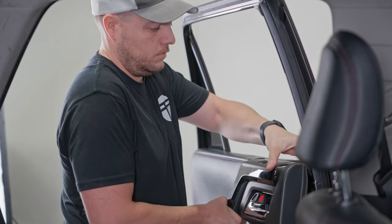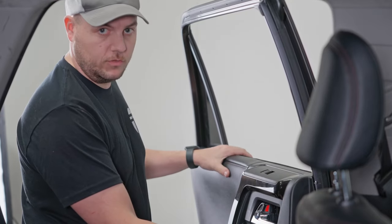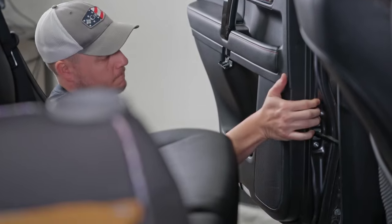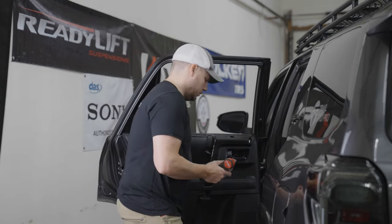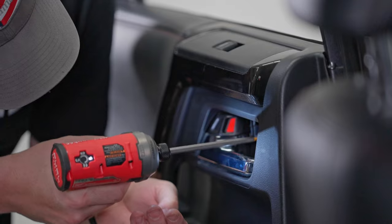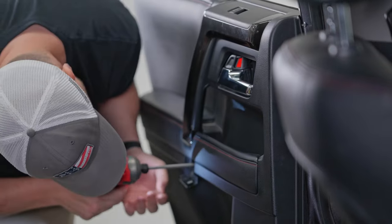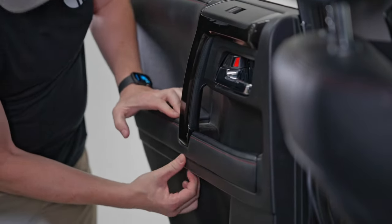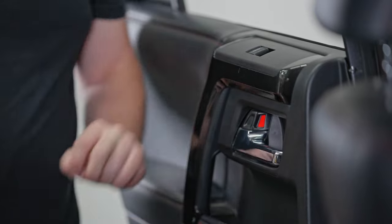Get the middle one, then lift up just a slight bit, squeeze, and now it's hanging on the top. Move to the retaining clips along the sides. Last step on the rear door is replacing the screws and the covers — again, the silver one goes behind the door handle, and then the two black ones go in the other slots. Place the cover pieces and snap back into place. We're done with the rear doors — all we have left to do is the rear hatch.